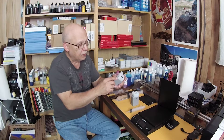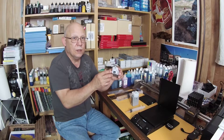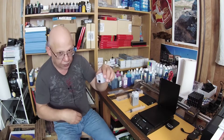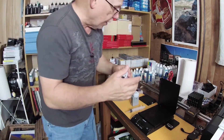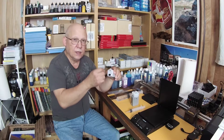First, you remove the cap by unsnapping two little catches. Use a flat-bladed screwdriver to carefully pry them apart. At that point, the little chip holder will fall out, so be ready to catch it before it does. Remember its orientation. The chip is held down via a couple of little welded spots, just like most other Canon cartridges, so you will have to break that and remove the old chip.